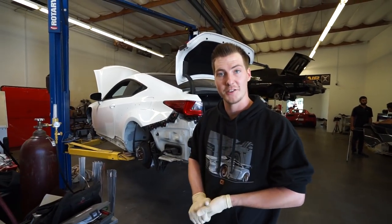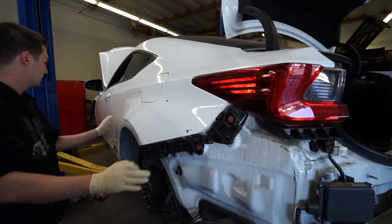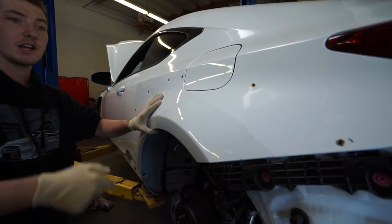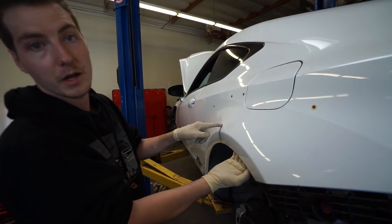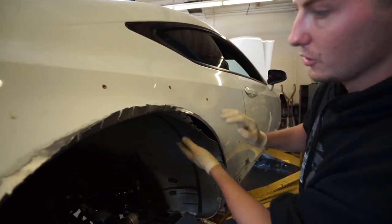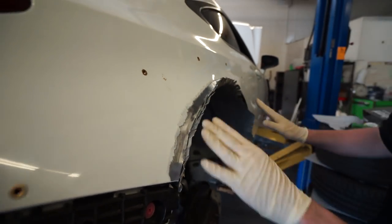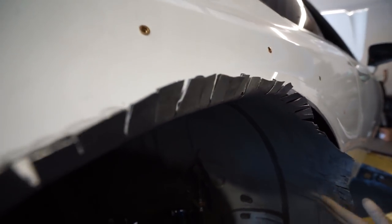As far as the progress update on this car since you last seen it, all the blue tape and everything's off. I went ahead and finalized each placement of every rib nut. Before, we just mocked it up to get the general idea, but now each one's threaded so screws can go into it. On the other side, we already started cutting and the process of massaging the inner fender liner back up to the cut, so we can go ahead and weld it and seal it all up. It looks a little ugly right now but it's still in the process. We still need to massage this inner fender liner to the cut, weld it, and then cut the extra metal off so it'll be nice and clean. It's a good, nice radius — gives us all the clearance we need for the bigger wheels, so there will be no problem. It's pretty much going to need to be more massaged, but it's in the process.